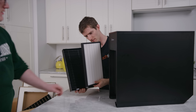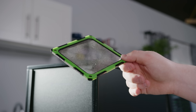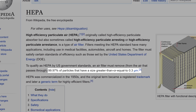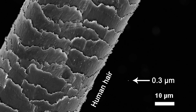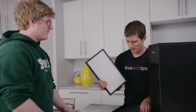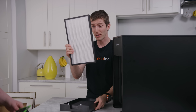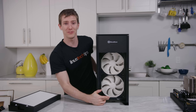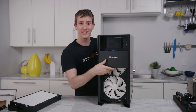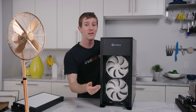Inside we find the MMO1's second party trick: a full-fat 20mm thick HEPA filter. Most fan filters are pretty good at mitigating dust buildup over the short term, but a filter like this is specced to remove 99.97% of particles larger than 0.3 microns — that's smaller than all but the smallest bacteria. Silverstone addressed the added airflow restriction with two massive 180mm Air Penetrator fans, which at max speed — controllable via knobs at the front — move a whopping 340 CFM of air, about the same as a typical pedestal fan at medium.